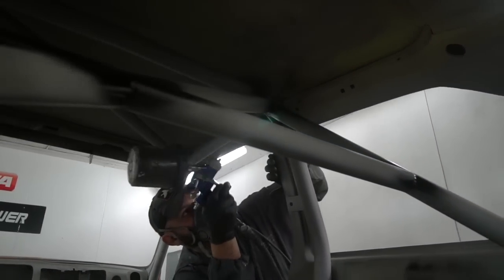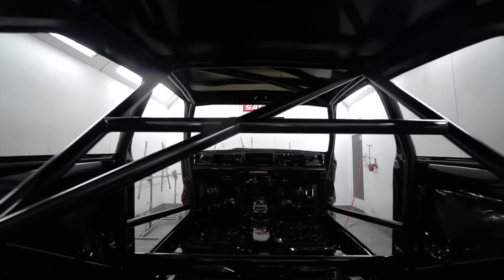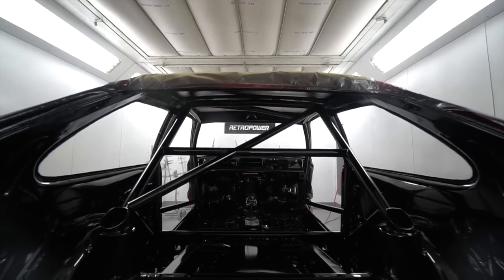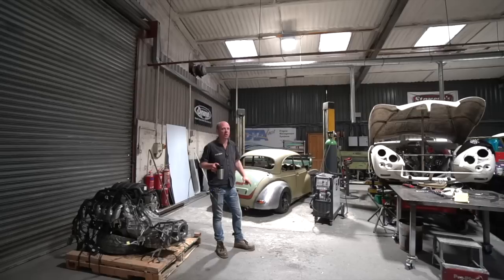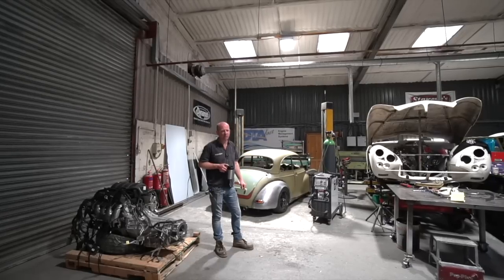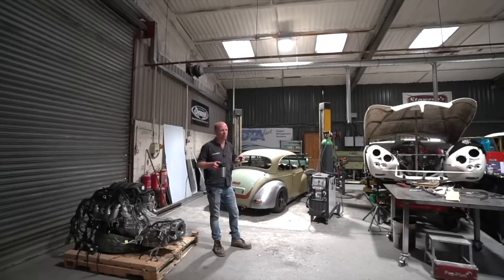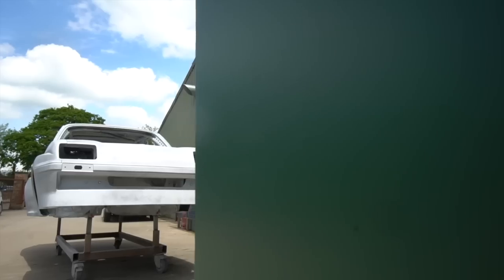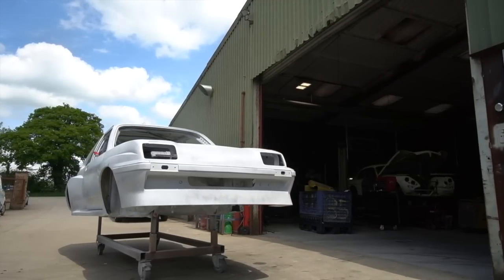Once the engine bay is painted, any areas of potential bare metal that only has primer on, or any seams or anything else that could get water into, are then sealed as much as is possibly practicable. We'll then wet flat the outside of the car, and then that'll be the final paint on the outside of the car. Prior to that, and I think we'd have covered it last week, at the primer stage it had a final mock-up of all the panels, which is pretty laborious and time-consuming, but basically we put them all back on again. Final check that everything fits, because the next time they all go together, they'll all be in paint and it's too late.